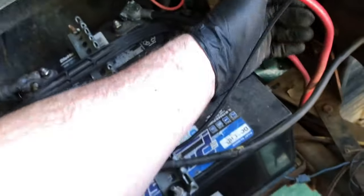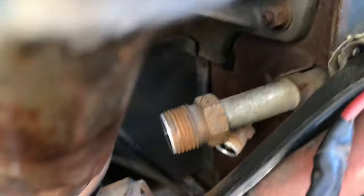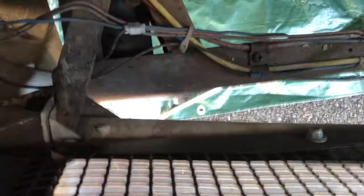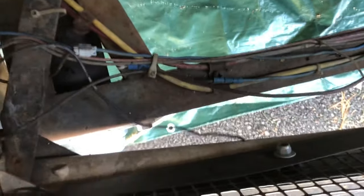Our lines to our compressor are going to be loose. There's one there, and this one here is going up into the evaporator. I'm going to get all this off and probably get this line off first just to keep working up here. Our evaporator is now disconnected. We've got a lot of wires down here going to nowhere, and at some point we need to go through and cut all these off and get rid of this mess.